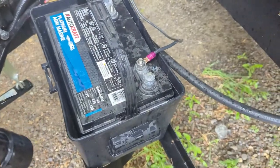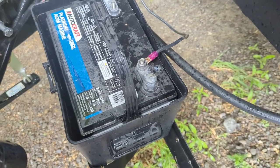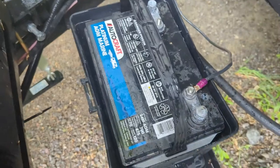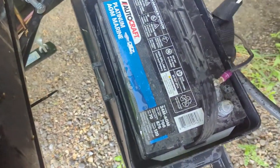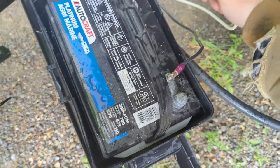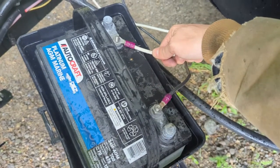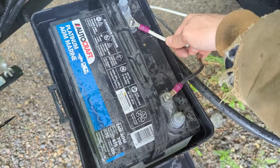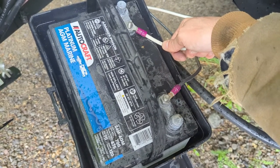The next thing I like to do while I'm outside the RV is if you disconnected the battery or brought it into the garage like I do and kept it on a trickle charger all winter, bring your battery back out and get it all hooked up. Be careful of the colors of the cabling — just like in the AC world, black is hot and white is neutral, so in DC, black is going to be your positive and white will be your negative.